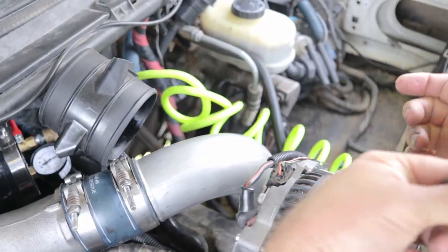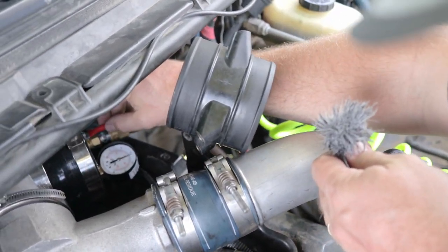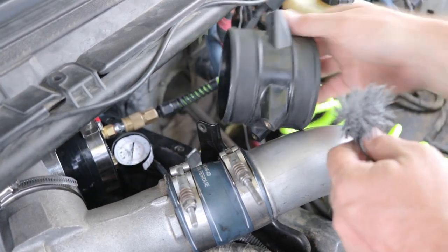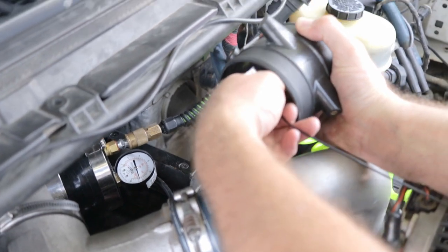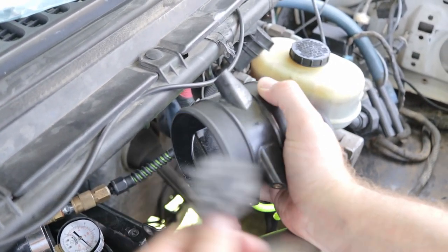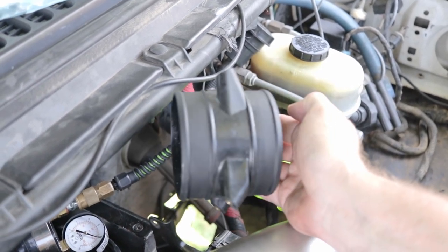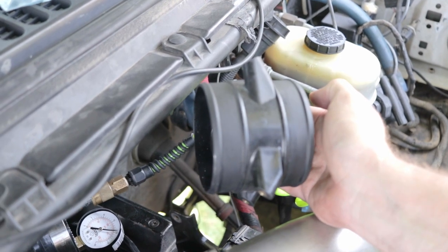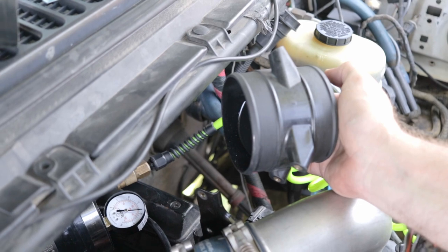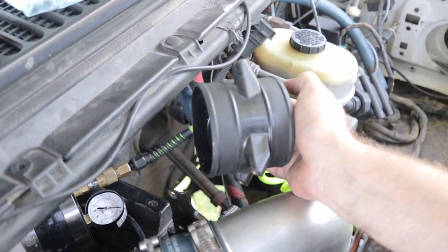All right, so I've got the mic out here. I'm just gonna boost this back up to 30. And then put this in this tube. That's coming from our crankcase ventilation. So I can actually feel it on my hand. So that's coming through the crankcase past the rings. So there's nothing I can do about that. Perhaps that'll seal up better if the engine's up at operating temperatures. Let's give that a try.